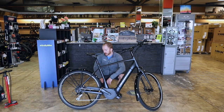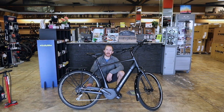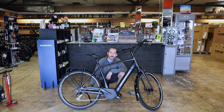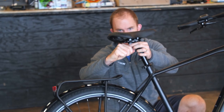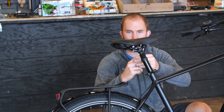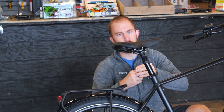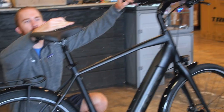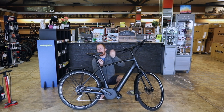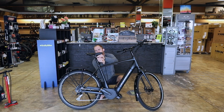Regarding tightening the kickstand: there are two bolts that mount directly into the rear of the bike. Check these on a regular basis because the kickstand tends to move around when you hit bumps and the bolts can come loose — they're lock-threaded on, but just check them once in a while. If you ever want to adjust the angle of the seat, tightening the front bolt tilts the nose down; tightening the rear bolt tilts the nose up. Try to get the seat pretty level or a little nose-up for comfort. If you feel pressure on the front of the seat, tighten the front bolt to tilt it down.